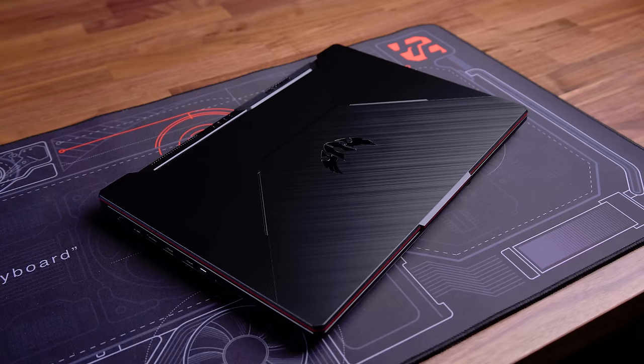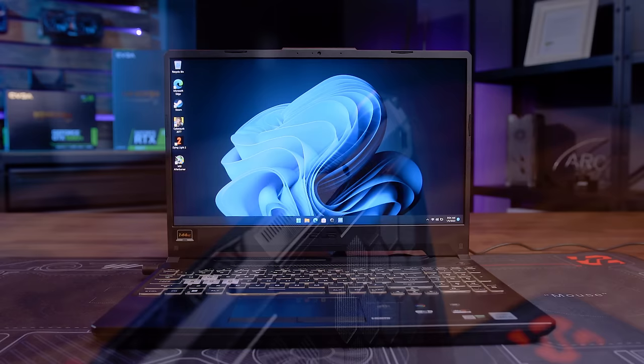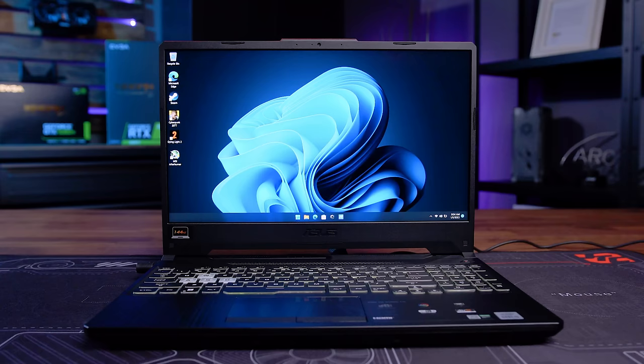It does have an available memory slot, which is awesome because initially I thought it was gonna be 2 4-gig sticks, which means it would suck if you upgraded because you have to toss a stick that you already paid for. But no, now you can keep what you've already paid for and add to it. And it has an available M.2 NVMe SSD slot, as well as an available SATA slot.